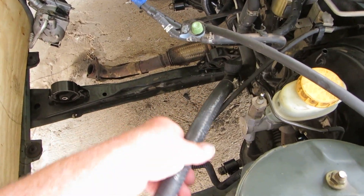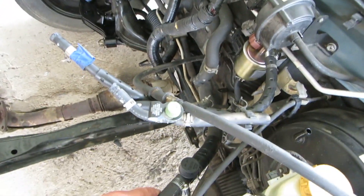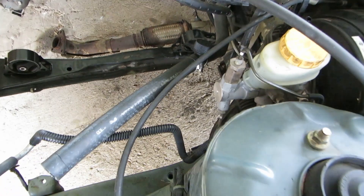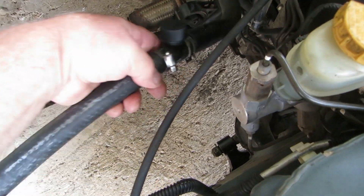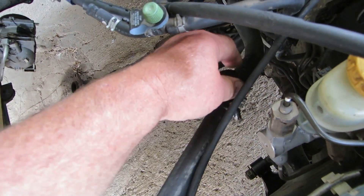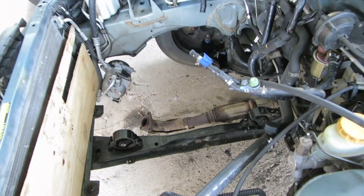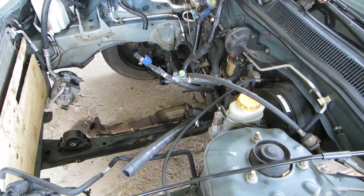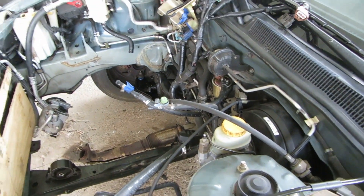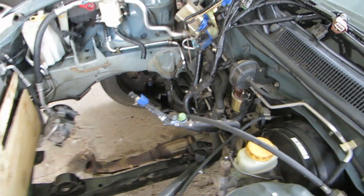My formed line for the heater core was all bloated from oil, so I put another piece of three-quarter-inch heater hose on it and connected it with one of these little Prestone T's. That way when you're putting antifreeze in, you can open that up and it'll allow the antifreeze to completely circulate through the engine because there won't be an air bubble. You can open that up so you don't have to wait for the head to get fantastically hot to open the thermostat. Also put on a new fuel filter.